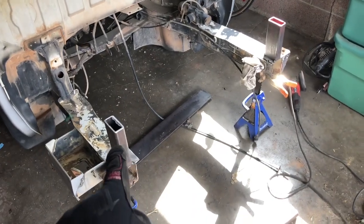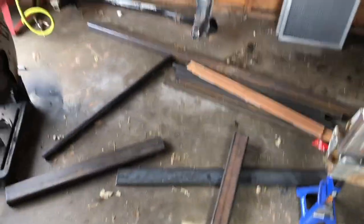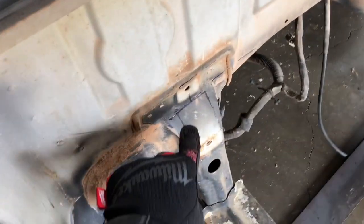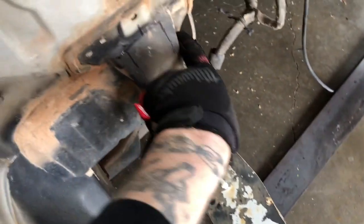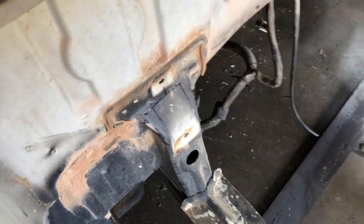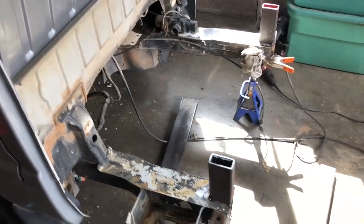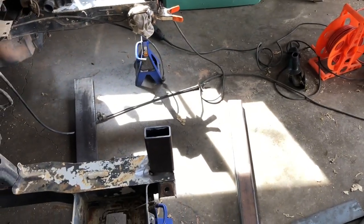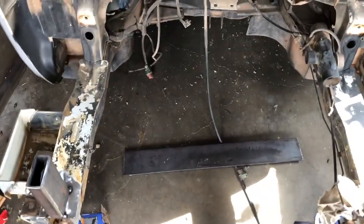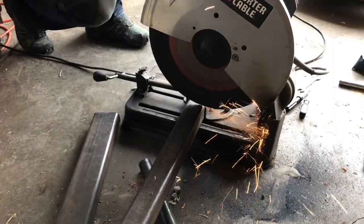Making good progress — we just got these little vertical pieces tacked in onto where we lobbed off the frame rails. We're about to cut this really long stick of two-inch square tubing into two 72-inch frame rails to go all the way back. We gotta notch out right here and put a plate in there to make it all strong. Me and Steve were saying we've got to over-build this thing to be safe. After we get the two frame rails in we'll tie them together with a crossbar, and that'll probably be it for today.